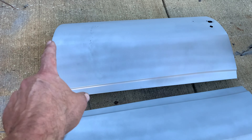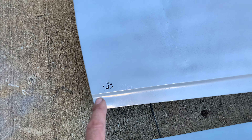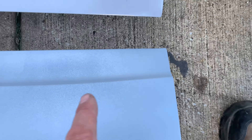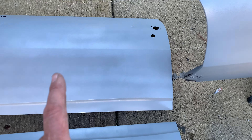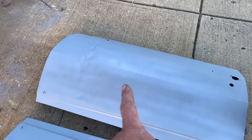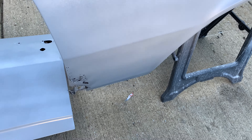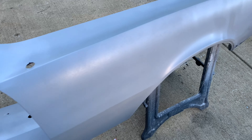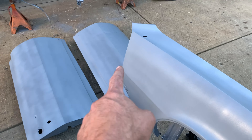We knew about the holes there on the driver's side door. I'm really debating that — maybe it needed to go a different direction. We know we have holes there and all that body damage up the whole thing. But here's something else that's kind of sad — the passenger side door looks great, but see these little specks here? That's rusted through from the inside out. I think it's time maybe to do a door skin. So I'm going to do a video on replacing a door skin. Even this passenger side fender — still not really loving this thing. It's a little worse than I thought it was going to be. So I'm going to maybe do some surfing on the internet, see what I can find for maybe a good used fender, and then maybe order up a door skin.